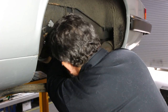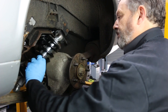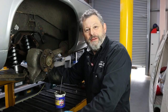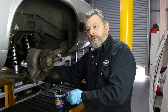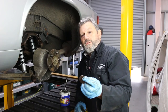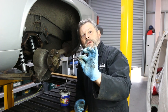There's a little bit of doing stuff by feel with these — it's even worse on E-types, there's far less space — but this is really quite glorious, I can get my whole hand up to the nut. I've got the bottom mounting in. There's a little spacer that goes on the front there which can fall out and disappear in the dirt if you're doing this outside — easily missed, but you need to make sure it goes back in so that the spacing top and bottom is equal. The washers that go on the bottom of the dampers are quite large; the reason for that is so that if the bush fails, the damper can't slide off over the top of the nut — it'll be held in place by the big penny washer.